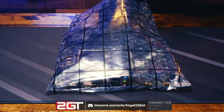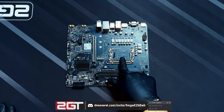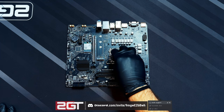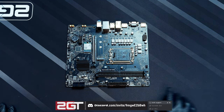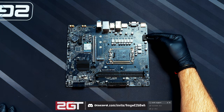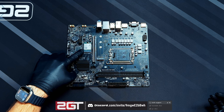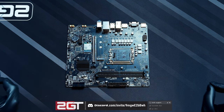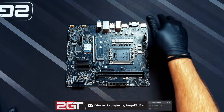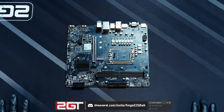Let's pull out our MSI motherboard. For those not familiar with motherboard components: this is the socket where the Intel CPU goes. The black plastic cover protects the pads underneath so the CPU doesn't get damaged. This is the single PCIe 16x slot where our GPU will go. Two DIMM slots for our two sticks of RAM. There's an ATX power connector, an auxiliary 12-volt power connector, SATA ports, a USB 3.0 header, a built-in Wi-Fi card, and the IO port cluster at the back.